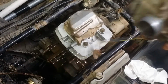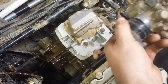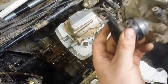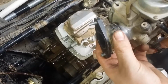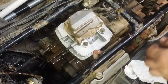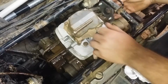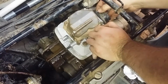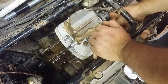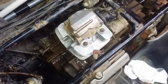I have said carburetor. Intake boot. You can see this notch on the intake boot lines up with the notch on the carburetor. So the intake boot goes like this with these thingies to the top. Aftermarket ones, I do not know how they fit. But I do know that this one fits. I have a fresh gasket here. Thread these down a little bit. Grab a power wrench.